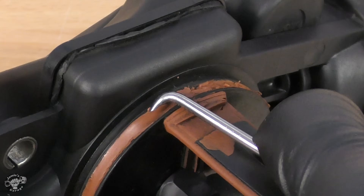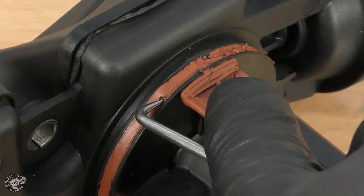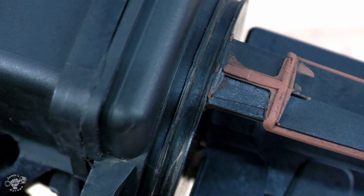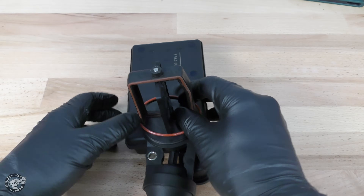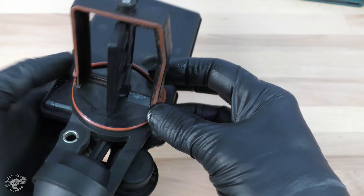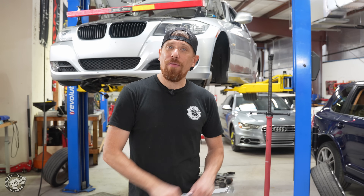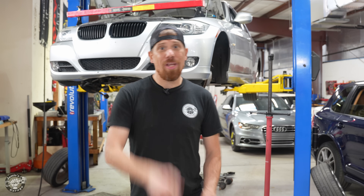This flattened, molded seal has to be scraped away to make room for a new O-ring. This does take some time and patience. It's very important to get all the little remnants out so the groove is as clean as possible. I then grease the new O-ring and slip it on. We now have a complete rebuilt DISA valve that's better than new. This DISA valve video was from the M54 engine build that I did for ChrisFix — if you guys want to check it out, I'll put a link at the end of this video. Thanks for watching.